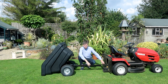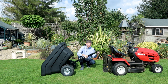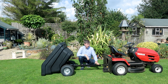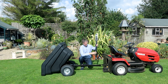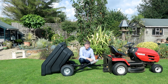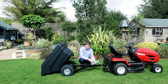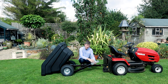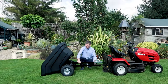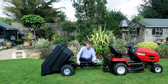There are a couple of options when ordering your trailer. You've got a pin option here — a lot of tractor lawn mowers have the pin, so you put it on, put your pin through and that connects it to your tractor lawn mower. There's also another option: the coupling hitch. On an ATV trailer or tractor lawn mower they come with a coupling ball, a bit like a tow on your caravan, and this hitch connects to that. You can connect it to your quad bike, your tractor lawn mower, or even a 4x4. Just make sure you get the right connection for the vehicle you're going to be using.